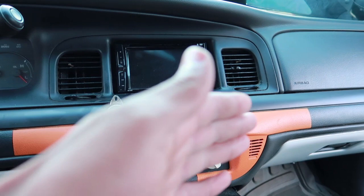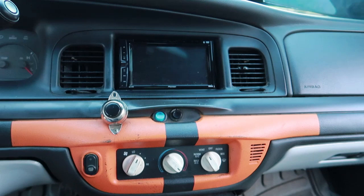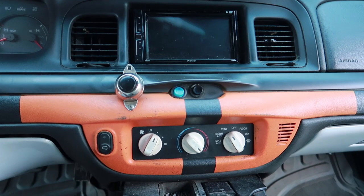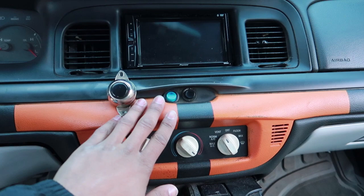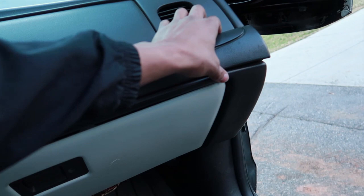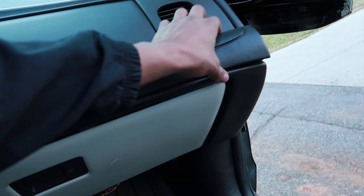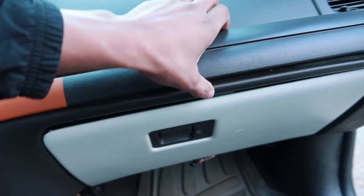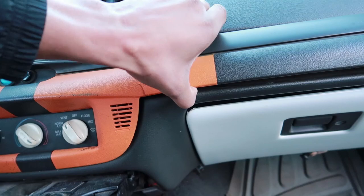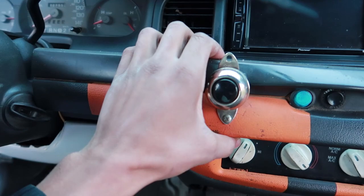First thing you're gonna want to do is find a location for your on/off switch. You can find this switch in the description below or go to AutoZone and purchase one yourself. To remove the fascia, it is held on by clips in the back. Start by reaching over here and just pop the end off — just keep going along and she's popping up. You do not want to snatch the whole thing out at one time because you will start breaking clips on the back, which is no good. Just keep going along and eventually the whole thing comes off.